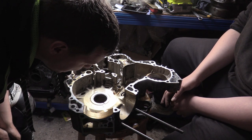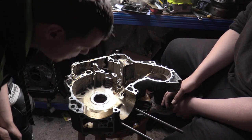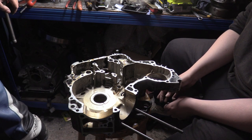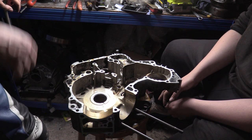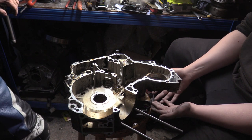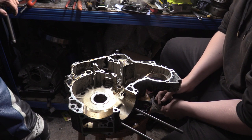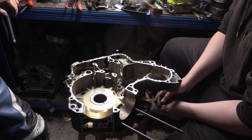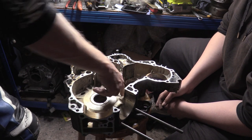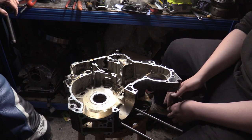What's the best way to do it? I've got a puller. A little small puller, but the claws on that puller are not going to get in there. What about a pusher? Well, you can't push it out, can you, twat? If we try and pack that with grease and force it out that way, hydraulically force it out, it's just going to squish right between the bloody races.